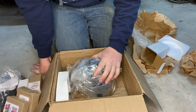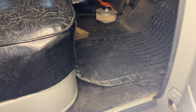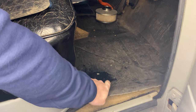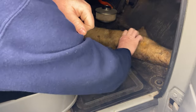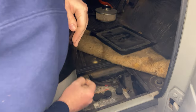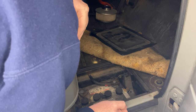That's everything I think I'll need — hopefully I don't have to run to O'Reilly's for anything today. Step one is removing the old 6 volt battery. On these old trucks the battery is in the passenger compartment, which is kind of odd compared to any modern vehicle. The previous owner said this battery was bought around 2015, so it's not super ancient, but it's a 6 volt battery — old enough to be useless — and we're converting to 12 volts, so we'll get it out.